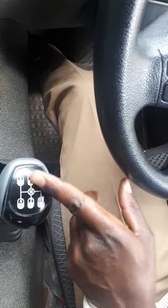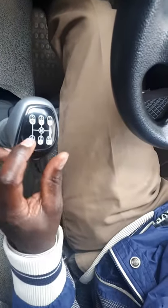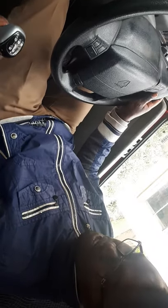So if you want to shift from number two to number three, you must come back to neutral first, then move to number three. The white represents the high gears and the black represents the low gears. This truck is a very powerful truck, so mostly on a flat surface it's good to start with number two low or number three.